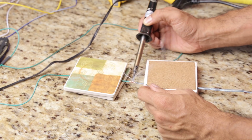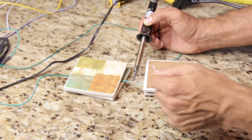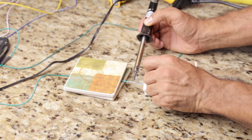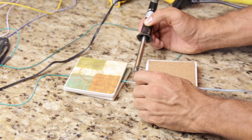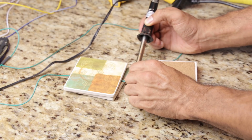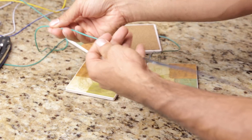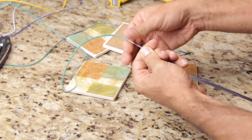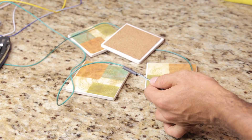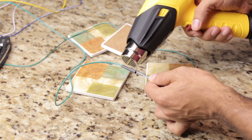Touch a small piece of the solder to the tip of the soldering iron and then press it against the joint to start the heat transfer. After a couple of seconds, touch the solder to where the soldering gun and the wires meet and then let the solder melt through the strands. Don't overdo it here — if you take too long you can start melting the cable shield. Put the heat shrink over the splice and then use the heat gun to shrink it into place. If you don't have a heat gun, you can always use a lighter.